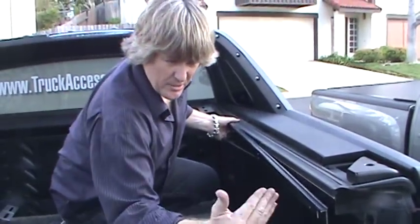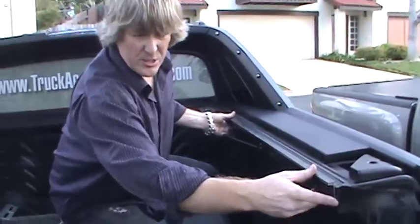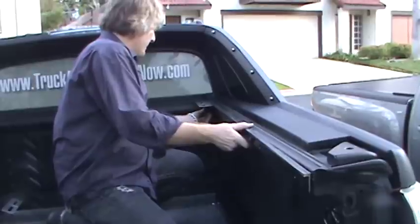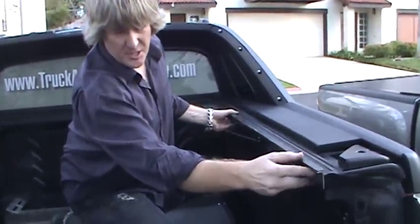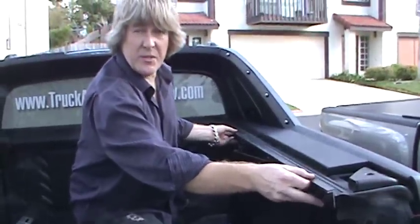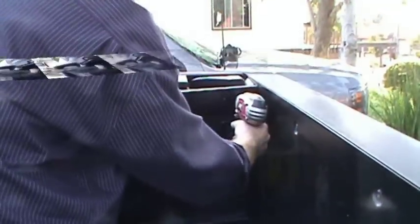So we're going to close the tailgate. We're going to locate this ¼ inch off of the tailgate so that there's clearance here. We're going to drill our hole in the front and in the back, and we're going to check our alignment. This is a slotted hole to give us adjustment, allowing us to adjust it up and down where we want the cover positioned. We're going to mount the rail, and then we'll show you how we mount the cover after that.